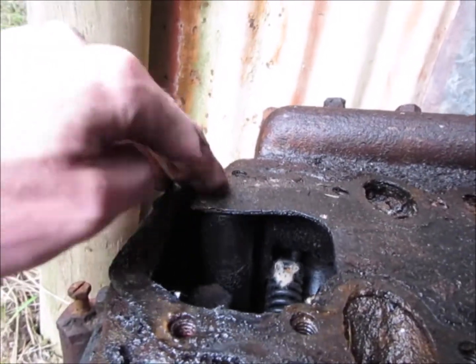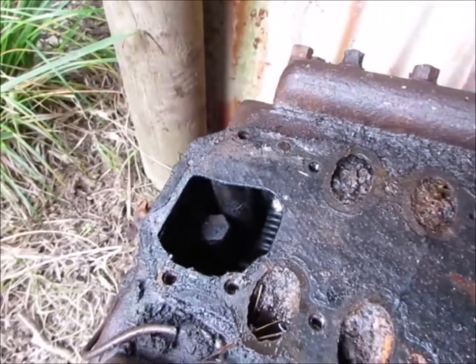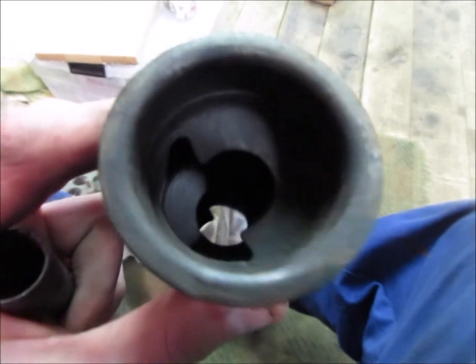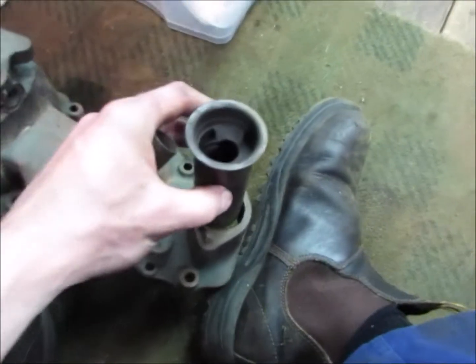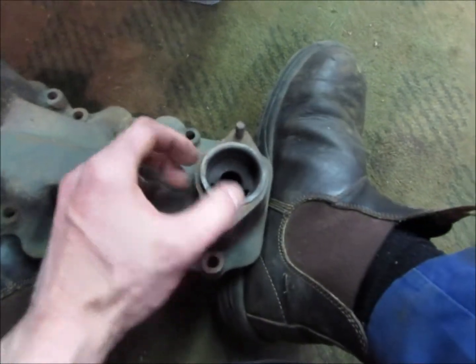This gasket nearly fully blocks that tube anyway, so I don't know. These aftermarket gaskets — they should be cut out around there. It also seems the trucks have a really elaborate oil separator system, and this is the tube which goes into the engine block through here. The car ones just seem to be hollow, so that goes in there.